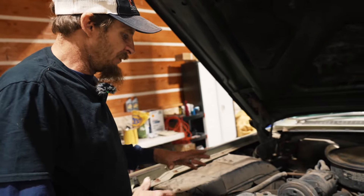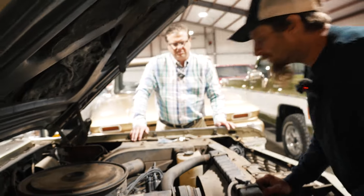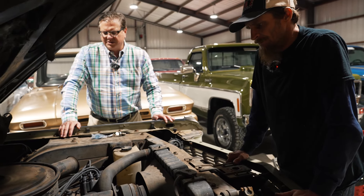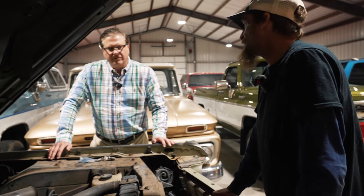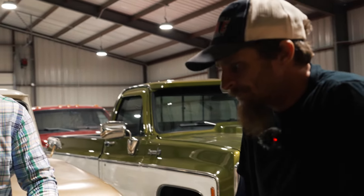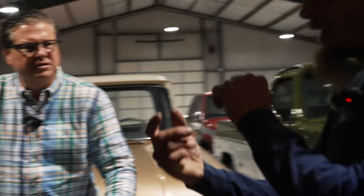My first plan is to get the ignition key put in. Once I get it to where I can turn it over — I've already put new plugs and wires in it — I'm just going to slowly move it, bump it around, and try to start it. I'm going to let it run for just a second and listen to it. The oil looks real good; I was really surprised. I ran my endoscope down the cylinders, looked in all of them — no rust, looked real good.